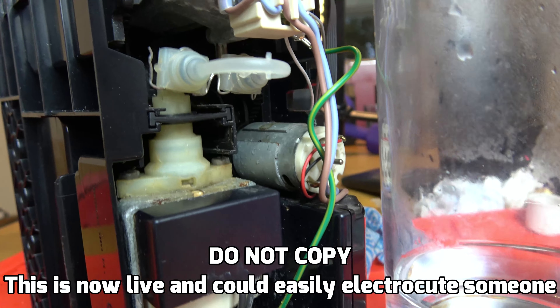There we go - we are now off. We have a little O-ring here. I wonder if it's just built up with scale or if the O-ring has failed. I'm going to take the O-ring off. It does feel quite hard. Looking inside - there's no scale on the inside, it's pretty clean. I think it might be just the fact that the O-ring has gone hard because it doesn't really feel rubbery anymore; it feels more like plastic. I'm going to see if I've got any replacement O-rings.